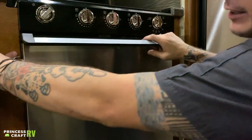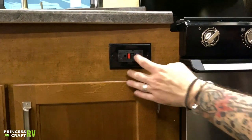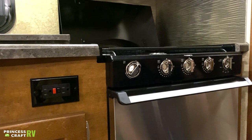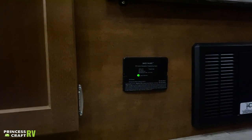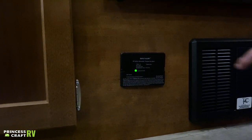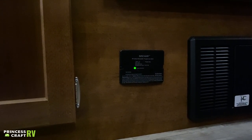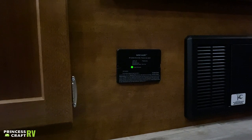Here is your main GFI outlet. All the receptacles are on the same circuit within the unit — if one gets overloaded, they all do. Push that red button to reset those receptacles. Down low, we have your carbon monoxide LP leak detector — a secondary piece of safety equipment. This particular detector is wired into the 12-volt section of the camper, so there are no batteries to change. It does have a test button and functions very much like a smoke alarm.